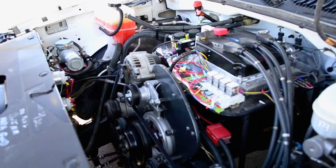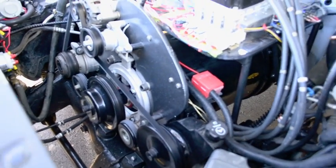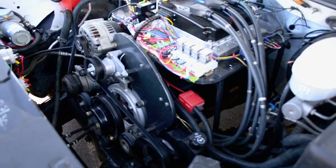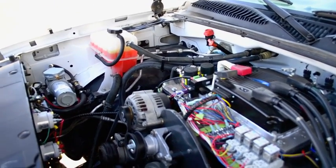With this new design, we are able to have an idle mode through a creep setting that is internal in the controller. The RPM of the motor is 400 RPM, which is enough to keep the power steering, transmission converter, and all those hydraulic pumps pumped up to where they're fully functional.